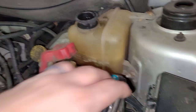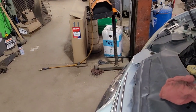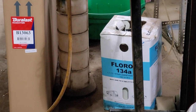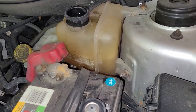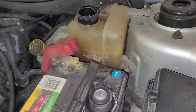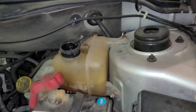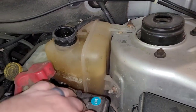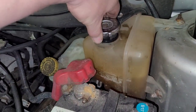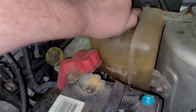The level's good. I used my sucker device — that thing works off air pressure and creates a suction. I took the hose, stuck it in there, and basically sucked the reservoir out. I got a gallon of straight coolant in there — I actually had to open a second bottle. The level should be perfect. I'm just going to put it back up in the air, recheck, and make sure I don't see anything else leaking. Obviously a hose being off is going to be a major, major coolant leak.